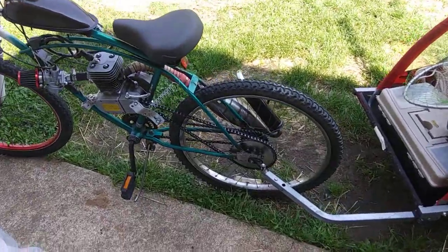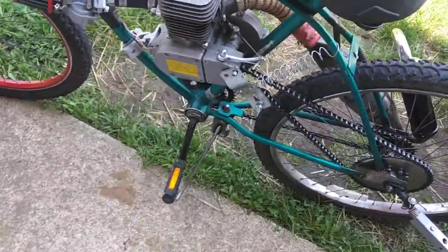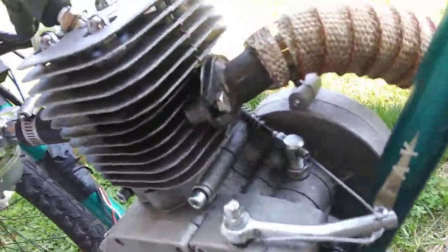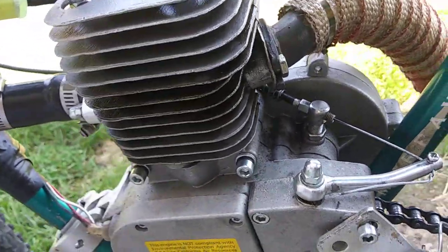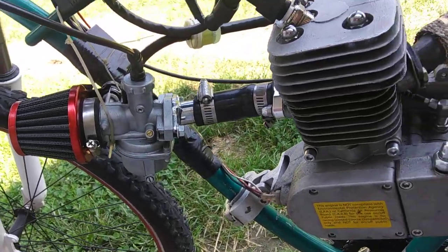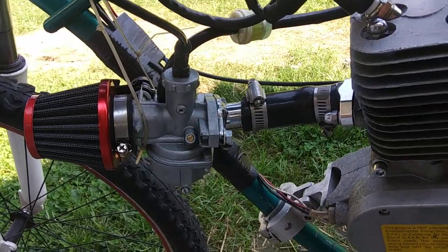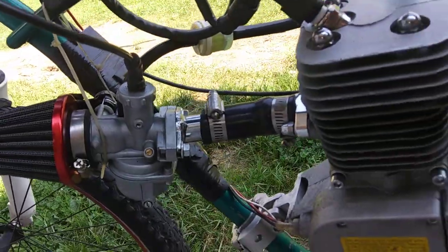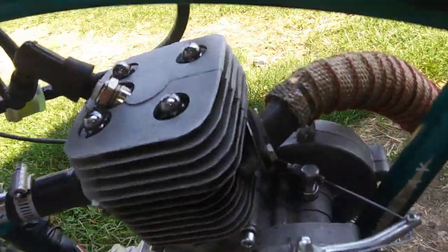Hello, welcome to my channel. I got my YD back up and running — drilled this out for a quarter-inch bolt, tapped it, everything's good. Up-jetted the carb a couple sizes and didn't really mess with the pilot at all. I lowered the needle one position because it was getting too much fuel down low.